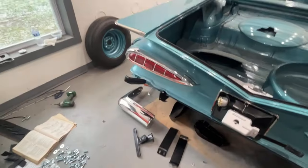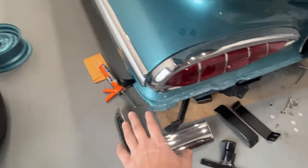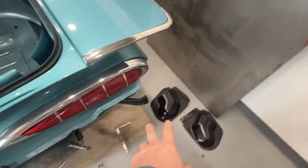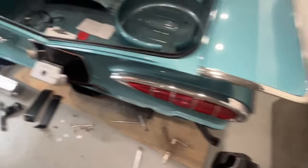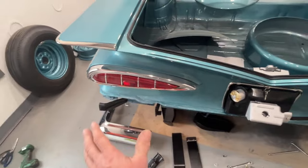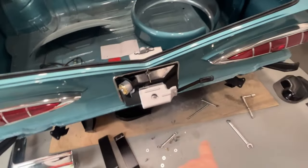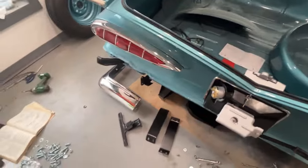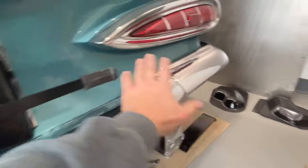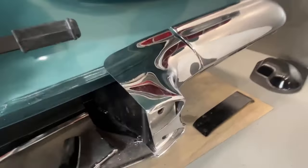I have the outer brackets mounted — they're just loose. I have this bracket mounted, everything's loose right now. I have all the brackets for the two outer bumpers to get mounted. Now I'm going to lightly bolt these on, leave everything loose, so I can get the center section on and figure out where all these other braces go. Everything is loose — nothing is tightened. I'm marking it all up loose so that I can mess with it.